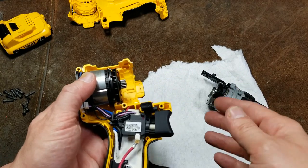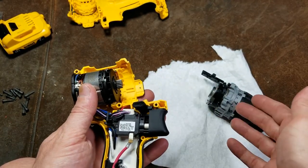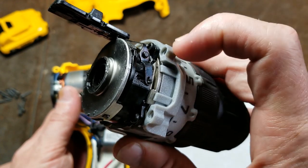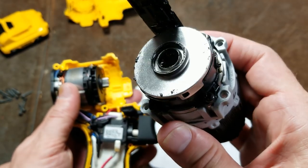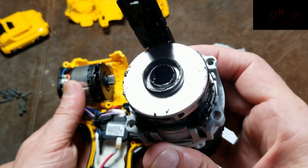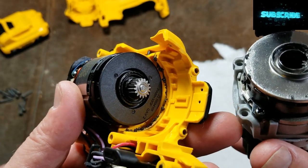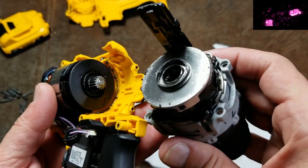It's a real pretty straightforward system to take apart one of these gearboxes. We can see that the gearbox actually has all steel internals. It is screwed together — that's a snap-on thrust cap right there. Overall not so bad; they have a convolution in there and quite a bit of grease. That's how they keep it in there — a little sealing convolution with that stamped piece of sheet metal.